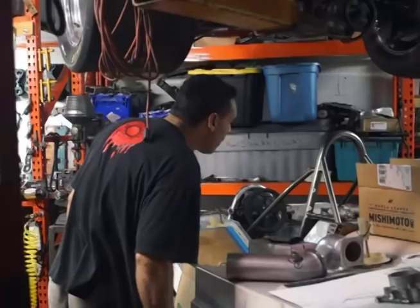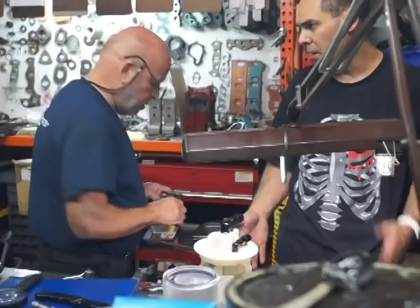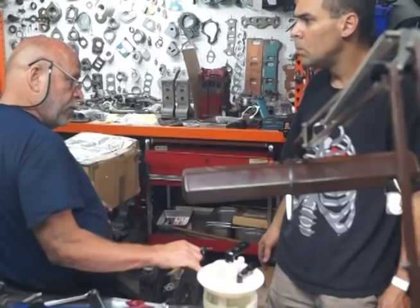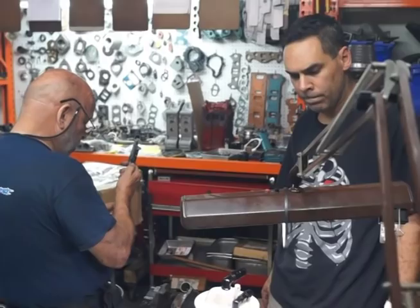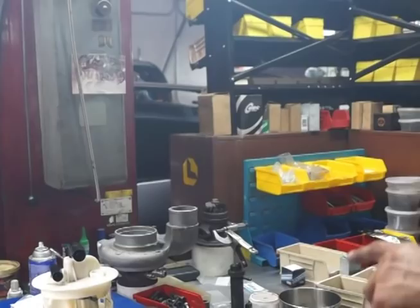Missing a spring. There's different Bosches though. Yeah, there's that pancake Bosch that has the insert, the strainer just like this, not inline. You're using an inline pump and putting it inside a tank. It works, but it's not as compact. I'm telling you, there's a Bosch half pump. That pump there, like the one that I got in the Miata, has a wide motor at the bottom. I haven't seen it. Those things are strong. I just don't know how they can claim all that GPM through that little outlet. You gotta see which one's power first. But even if that side's not connected, you'll get fuel pressure because the one side will be feeding. And even though that side's not connected, it'll still maintain the tank levels because it's returning to both sides, regardless.